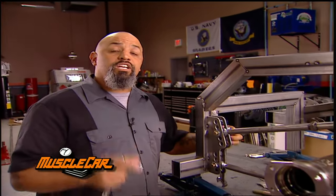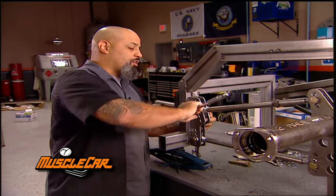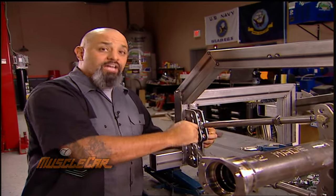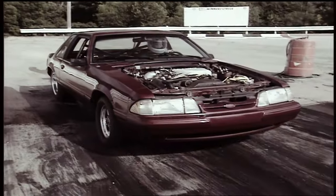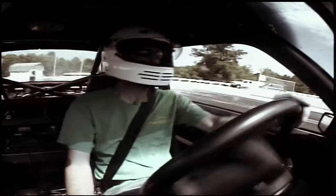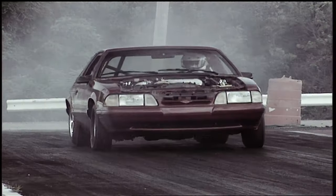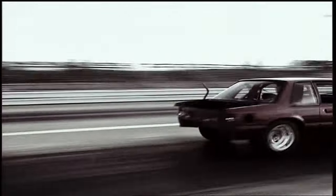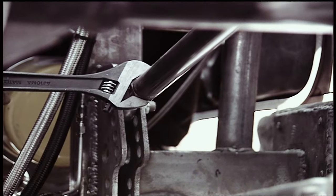All this tunability could be a blessing, but it can also be a curse. There's thousands of theories on how to adjust one of these. Here's mine in 30 seconds or less. Last year, I put one on Mike Galley's Mustang project, then tuned it in. On the initial launch, it pulled some to the right. So I shortened the top bar on the passenger side just a bit.